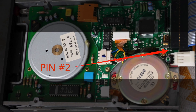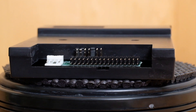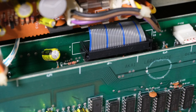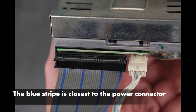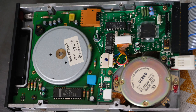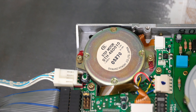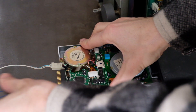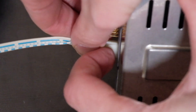Make note that the blue stripe on the data cable connects to pin number 2 on the old floppy drive. Pin number 2 on the GoTek emulator will also receive this blue stripe, and the blue stripe will align with pin number 2 on the PC board in the sampler as well. Here are some photos of the original floppy drive removed from the S900. An even pull removes the data cable from the old drive, and lifting the small tab on the power connector while gently pulling makes the cable easy to remove.